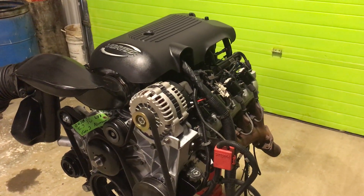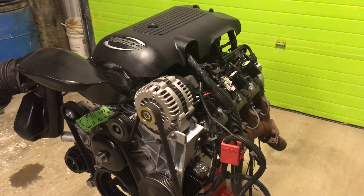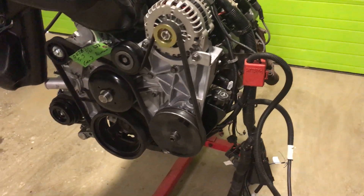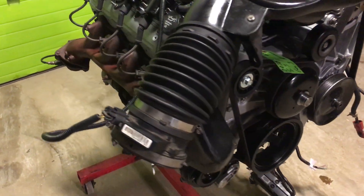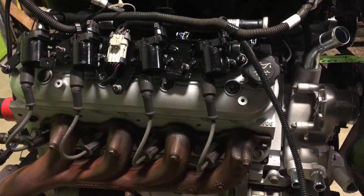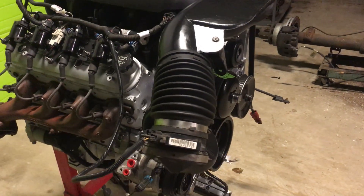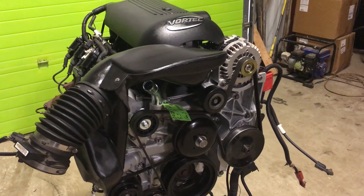You're looking at a complete standalone 5.3 all-aluminum engine — 1999 to 06, or old body style OBS 07. These engines originally came in 05, 06, and OBS 07 extra cab Chevy and GMC trucks. We love to rebuild them — they're peppy as hell. These are also great engines to supercharge or turbocharge because of the thick wall castings; since the piston's small, they didn't bore it out to 4 inch or 4.065 inch, so there's lots of meat left in this engine.